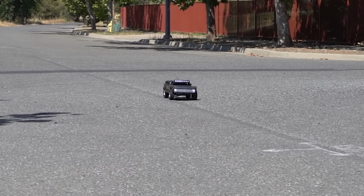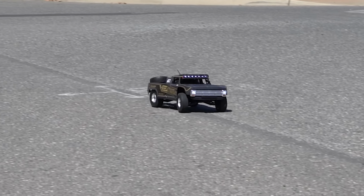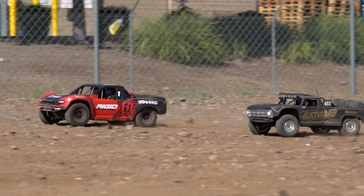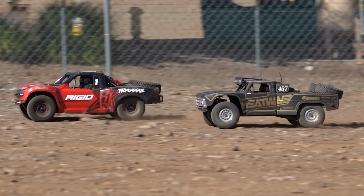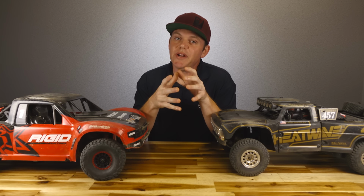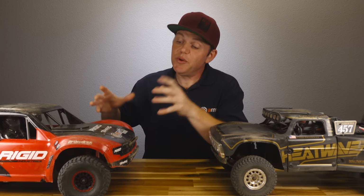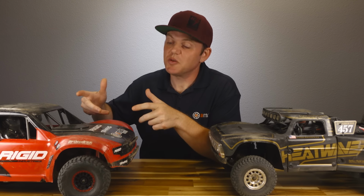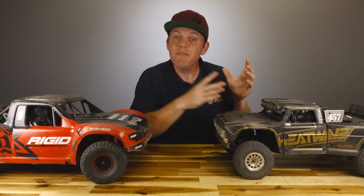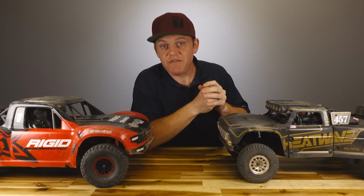If the truck had a front sway bar, it would help lower the torque twist, but out of the box, it grips, rips, and twists. Now with the UDR, torque twist is not an issue. With that locked rear axle, full sway bar support, and harder compound tires, there's little to no flex out of the UDR chassis. Generating traction is a big difference between these two trucks, and the BR2 just does it better, where the UDR tends to have a whole lot more just tire spin. You could of course just lock up that rear diff in the BR2 to try it out, or try to mimic the effects of the UDR by adding some plugs or just heavier diff fluid.